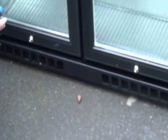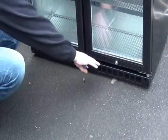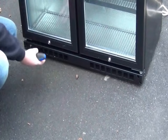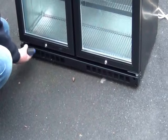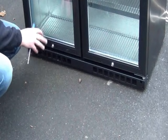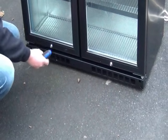First of all, you've got these two grills at the bottom — this is where the fridge breathes. It draws cool air in one side and expels the warmer air out the other side. Because these cabinets are designed to be built in tight to bars, this is the only place where the ventilation is. So ensure this is kept clean — check it every week and give it a wipe down with a damp cloth. Make sure no dust, dirt, or any bits of paper or anything gets stuck in the grills.